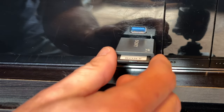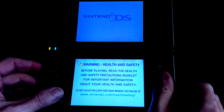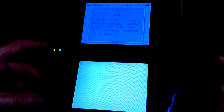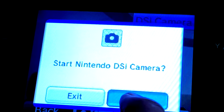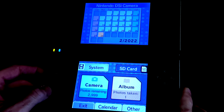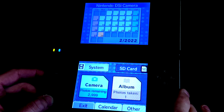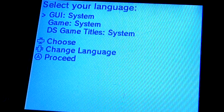Remove the SD card from your computer, insert it into the right slot on your DSi, and power on your system. From the main menu, press the left and right shoulder buttons together to activate the camera application again. In the bottom touch display, tap the button that says DSi Camera, and at the confirmation prompt, tap Start. Then tap SD Card in the top right corner and tap Album. You should see a flash of colors and be taken to the Twilight Menu++ language selection screen. If your system language is the one you want, just press A to continue.